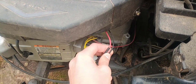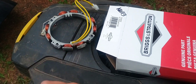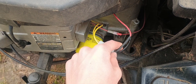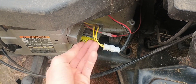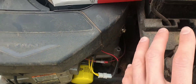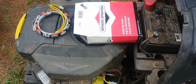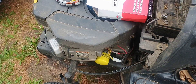So the reason I'm replacing the stator is because it has the wrong one in it. For some weird reason, they put an unregulated dual circuit alternator in it and plugged it into a regulator, which this one is not supposed to use. The tractor is supposed to have the regulated one because the headlights run off the battery, not the 14 volts AC.